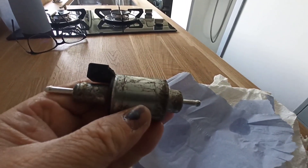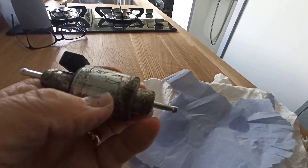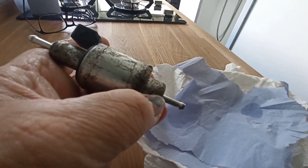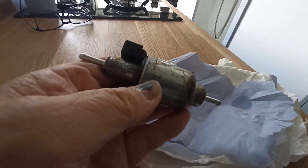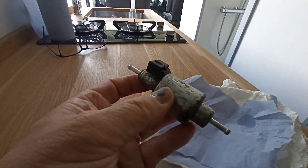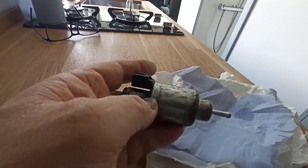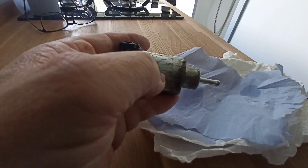So even when the pump stops, you're going to get a small amount of diesel passing through the pump into the burn chamber. Now it may just stay in the chamber depending on which way you've got it mounted, it may come out the exhaust, it may feed back and come through the inlet side, but you're going to get a build-up of diesel in the burn chamber. So when you start up you get a hell of a lot of smoke, and depending on how long it's sat before you try and start it up, it can look like your van's bursting into flames because of the amount of smoke.